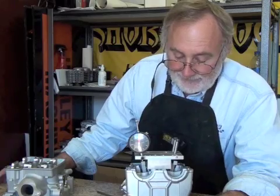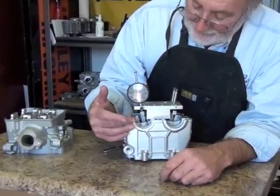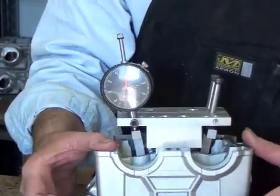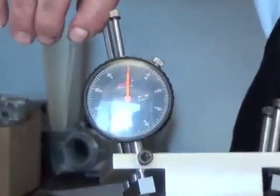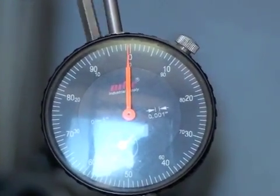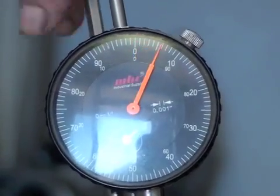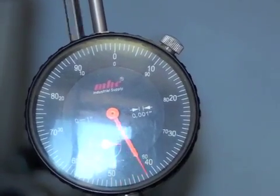What we're going to explain first is the fixture. We make our own fixtures in-house. What this fixture does is it's designed to open the valves up. We test at 50 thousandths increments, so we'll put this in here like this and we'll open the valve and test that every 50 thousandths.